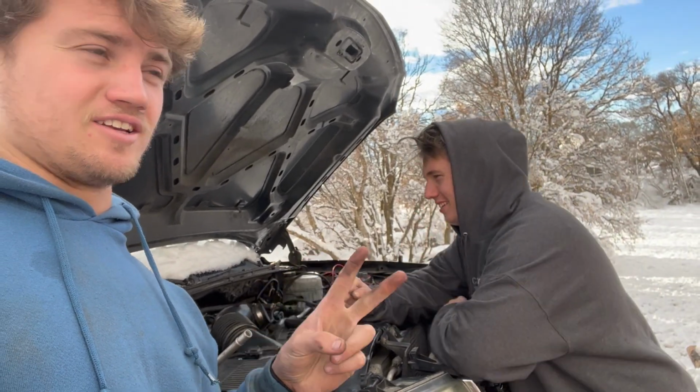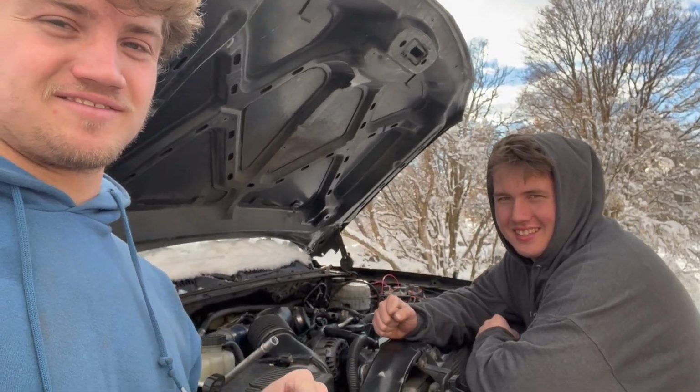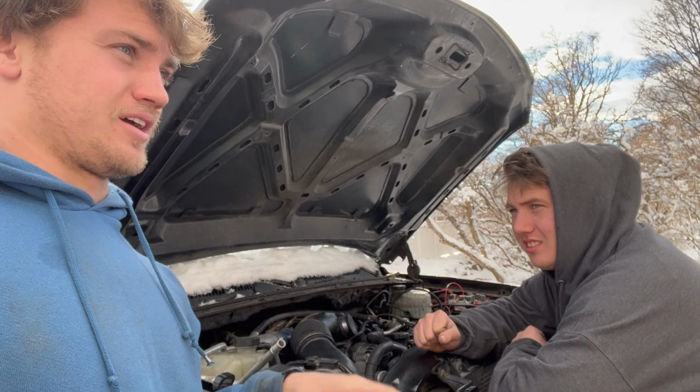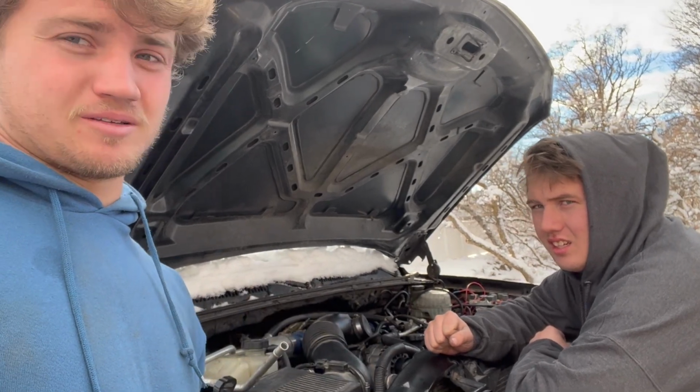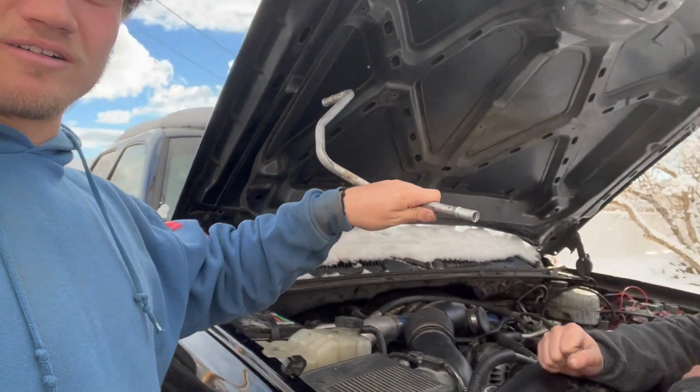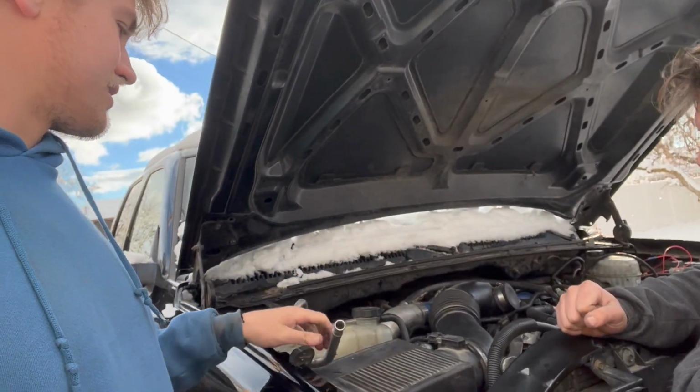But not very good. It drives just not very good. Smokes a lot. Got a fuel issue somewhere. And our air dog, we have to fix our sump. So we got to put some more diesel in it and maybe some injector cleaner and see if it cleans out. It's got a coolant leak. It's a bad girl. Got to fix that.